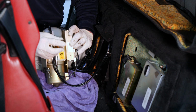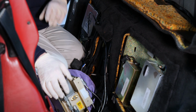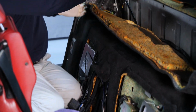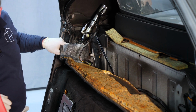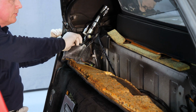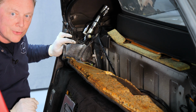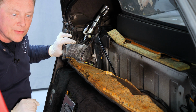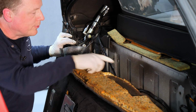If you have this valve closed, then it's impossible to pull the shafts out manually. So with 1 to 2 turns opened on this pressure relief valve, you can manually pull the shaft just far enough to get the mounting pin back into the rod end. Fasten it and repeat the same thing on the other cylinders, and with that we're practically done.